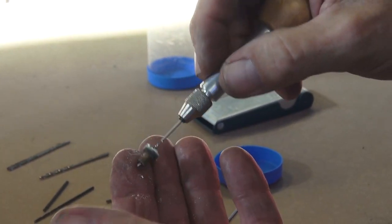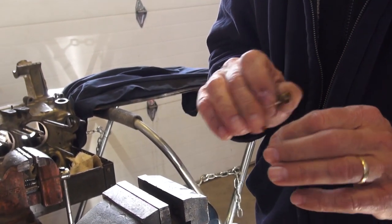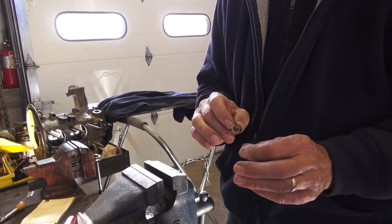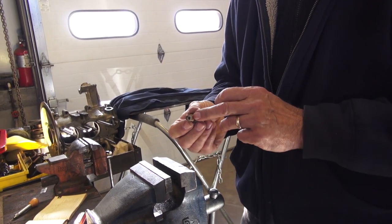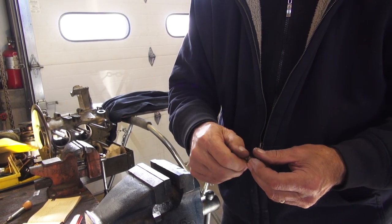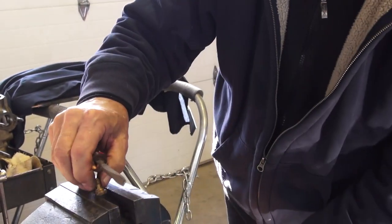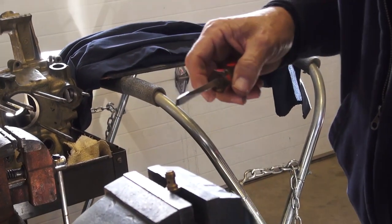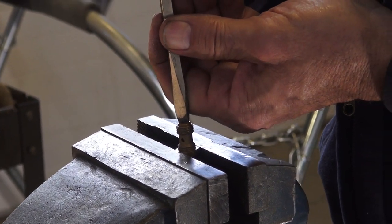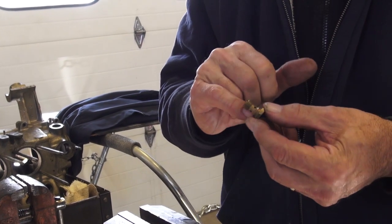I'm pulling out even more crud. This is the plug that holds the jet. After you clean it out, make sure you use carburetor cleaner to blow out any contaminants or residue that you've loosened up, then blow it out with compressed air — blow the plug out too, because the jet needs to sit in a nice clean plug. Start it by hand, then put it in a vise to snug it up nice and tight. Now it's ready to be reinstalled in the engine.